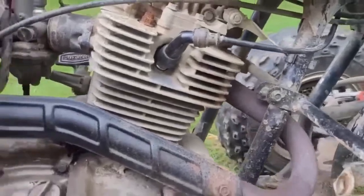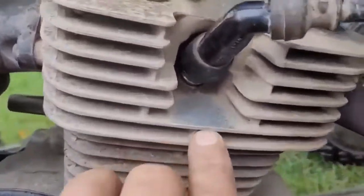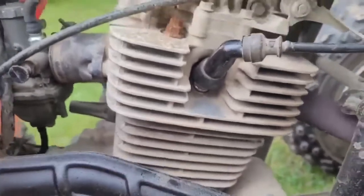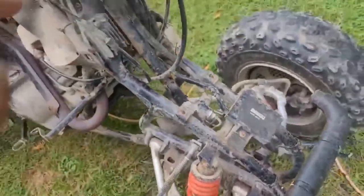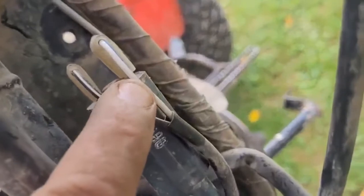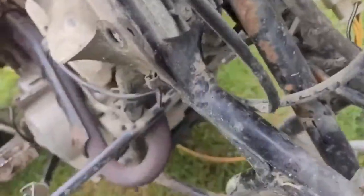Here's a quick rundown of what we did so far. We pulled out the plug and checked the spark plug, cleaned up the area to make sure we're getting good ground, put the spark plug against the frame, turned it over, and weren't getting any spark. I had a spare coil, so we tried that — you've got to get your front plastic off, get the coil off. It has two wires: a white with a blue tracer, and a black wire with a white tracer. Replaced it temporarily — that didn't do anything.